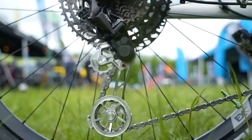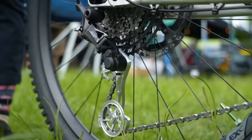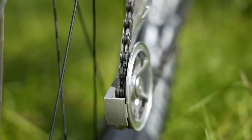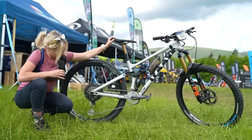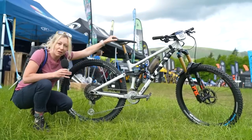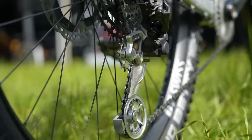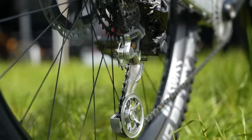The two riders, Chris and Torben, are engineers and they've obviously started to play around with their Shimano XT derailleur. Chris tells me he's CNC machined this out of a piece of aluminium and the top jockey cage is a lot stiffer, making shifting more precise.